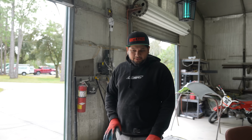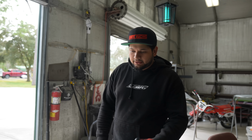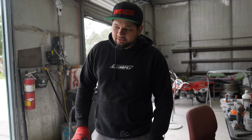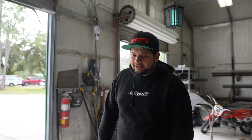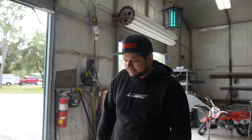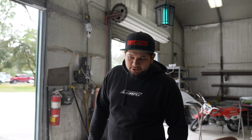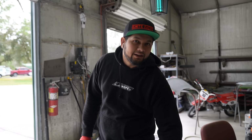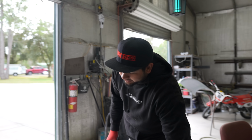So you first want to figure out what you want to do with this. Since you're going to do body work and you're going to get rid of these spots, you're either going to be 180 or 80 grit. Okay. I'm leaning towards 80 grit. Yeah. Just because that's going to get you where you need to be faster. It's not a bad panel though, so you could do 180 if you wanted. Just takes a little longer.